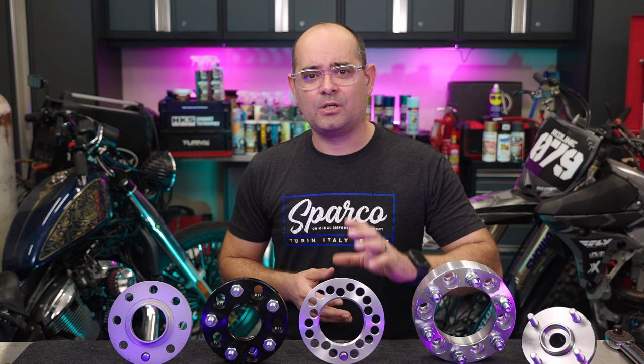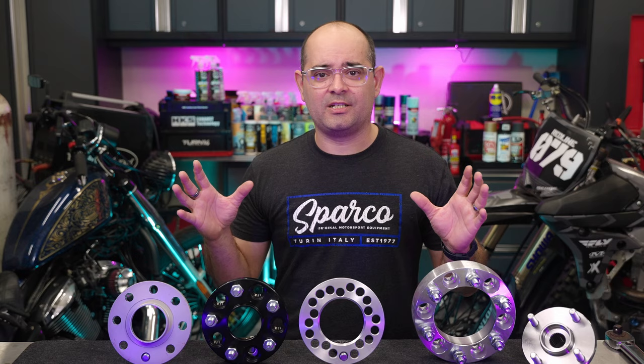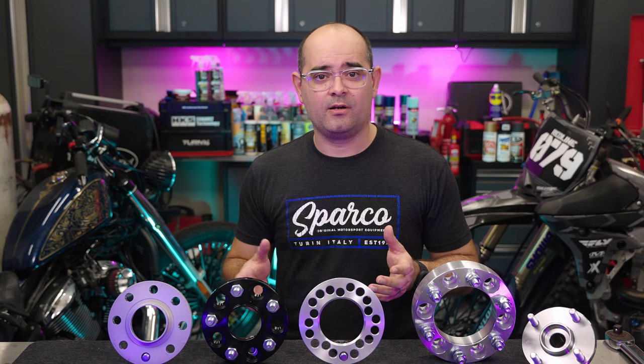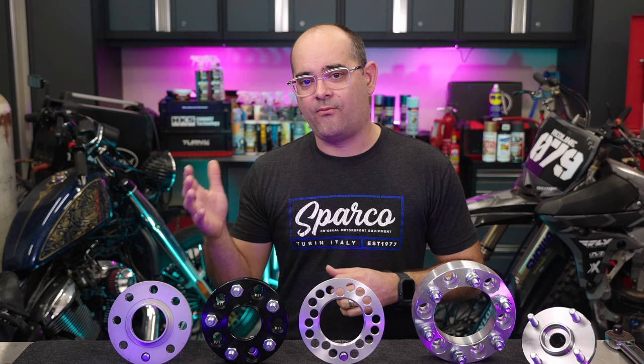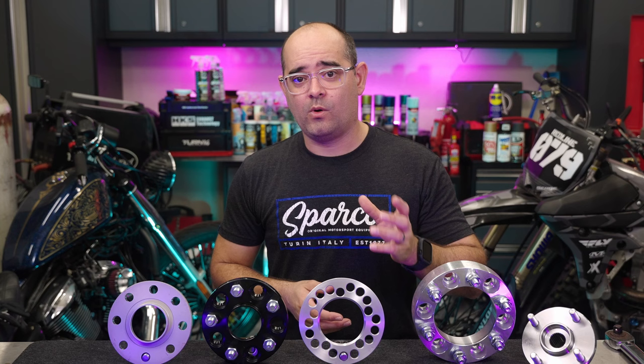Another common issue comes down to the quality of the product. The market is saturated with brands ranging from under ten dollars to over $150. While we won't say which is specifically best, you obviously aren't going to get good quality at the cheapest price — and given the potential dangers of a spacer failure, it's not smart to cheap out. You want spacers CNC machined from billet aluminum — 6061-T6 grade aluminum is what we recommend for proper strength — and the bolts should be genuine 10.9 grade bolts, usually stamped on the bolt head, though be wary of fake markings so purchase from a trusted source. Ultimately, the answer to whether spacers are safe is yes, assuming you purchase high quality spacers and install them correctly.